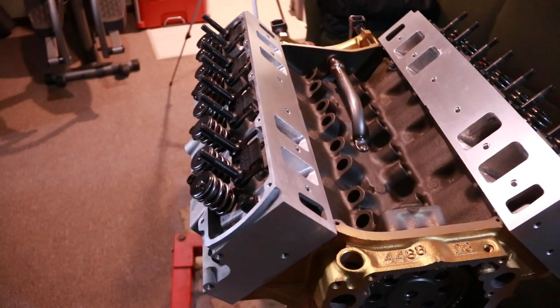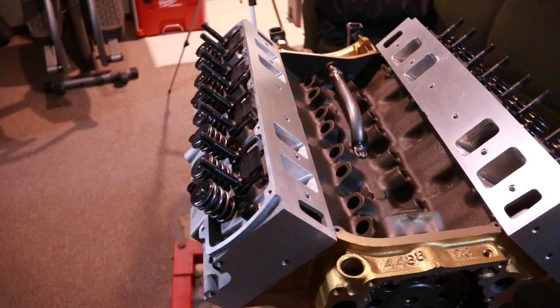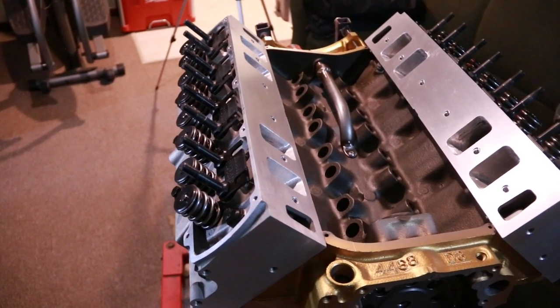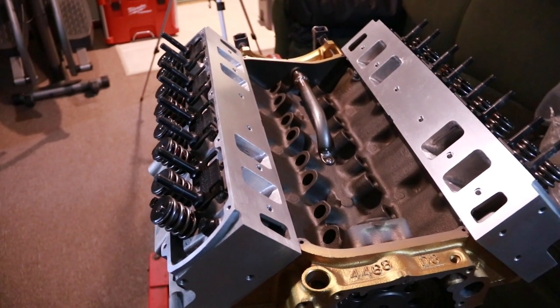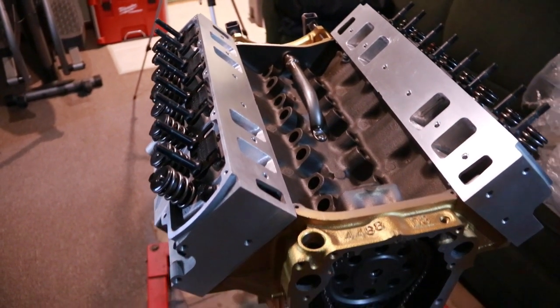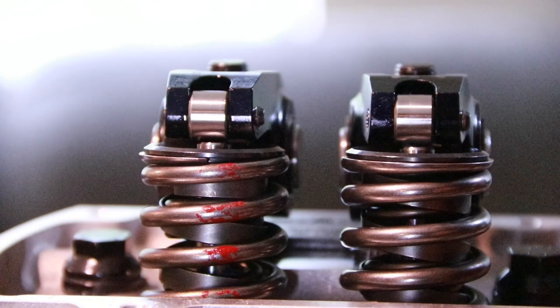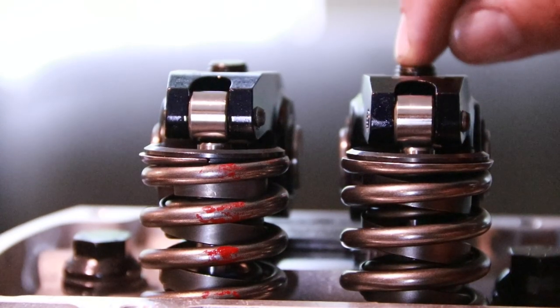One more step of the way. I'll get these rocker studs swapped out and then start checking for push rod lengths and get the lifters put in. That way all that stuff can be checked, push rods ordered, and continue on. Now I've got the studs swapped out.